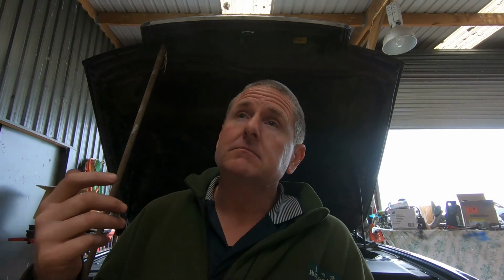Not too worried, and it gives us a good opportunity to go over this on a real car. What I'm going to do is check the wiring, because I have had this one apart. The loom has been to pieces. It's had the loom under the manifold repaired. It's got a different ECU in it, so lots of potential there. This vehicle, when it came in, didn't give me good fault codes, and the computer was stuffed. So I'm not surprised now that it's actually picking up faults. And they've probably been there for a long time, and they weren't exposed because the ECU was faulty.